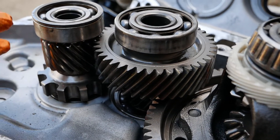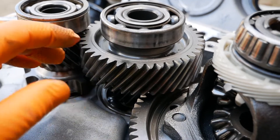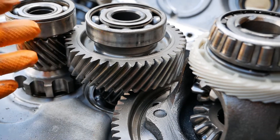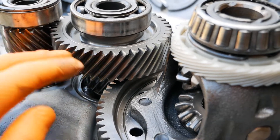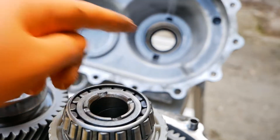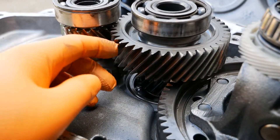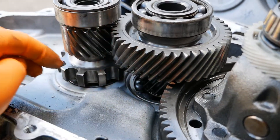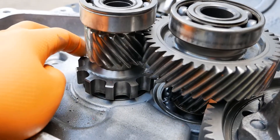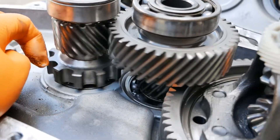You may have seen one of my videos about changing oil on Nissan ENV200s and Nissan Leafs. On those reduction gearboxes at around 60-plus thousand miles I have seen small chunks of metal in the oil when you drain it, because those do have magnets on the drain plugs. Those gearboxes clearly aren't up to the task, because this drive shaft obviously does spin very fast — much faster than a combustion engine vehicle.